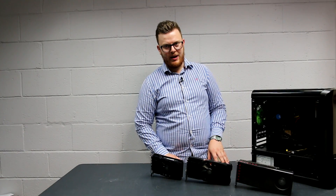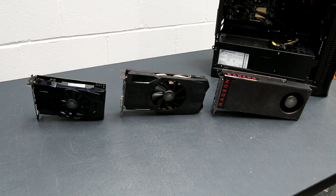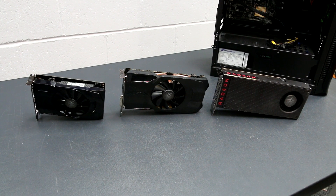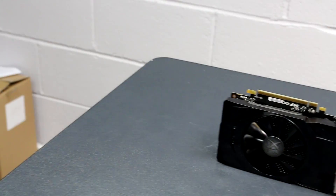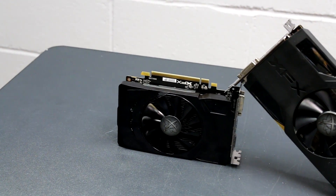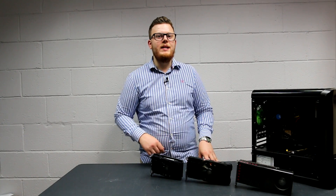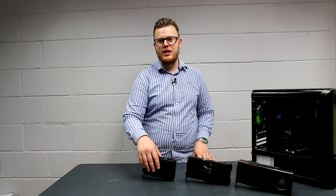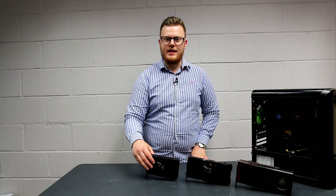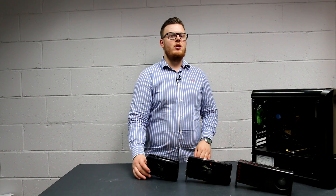This one comes with a 6-pin power connector, as does the standard one. The RX 460 has 896 stream processors with a boost clock of 1,200MHz. You can have either 2 or 4GB of VRAM — in this one we have 2. It has 2.2 teraflops of performance, a memory clock speed of 7GB per second, and a TDP of 75W. Normally the 6-pin power is not required, but on the XFX version we've got here, we do have one. With a TDP of 75W you can normally draw that from the PCIe lanes, but I guess after the RX 480's issue drawing more power, they decided to add a connector. Either way, yours may not have one if you buy one.